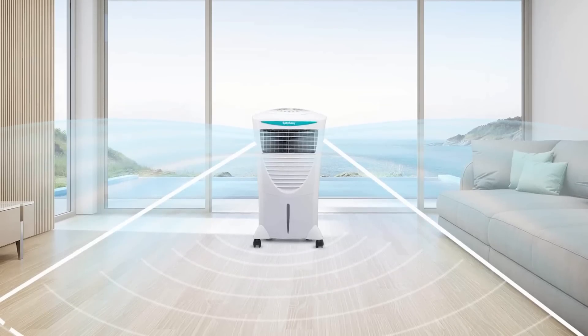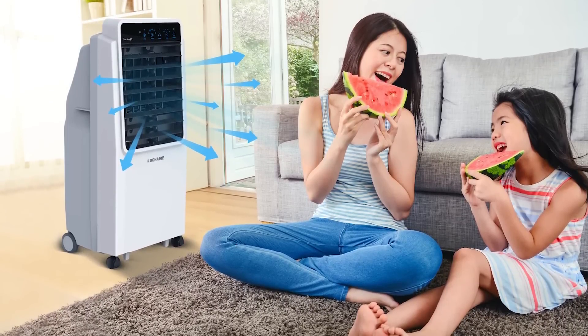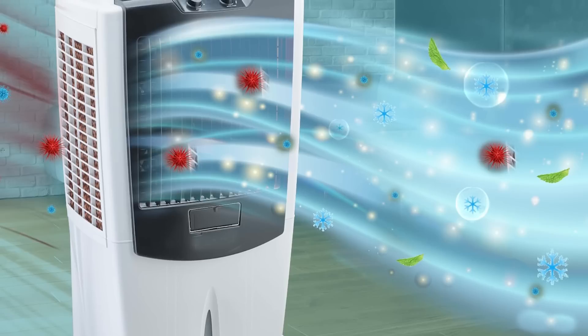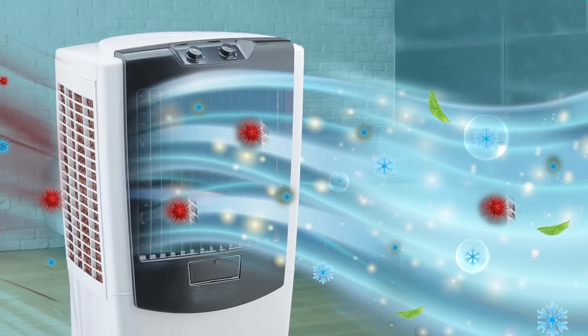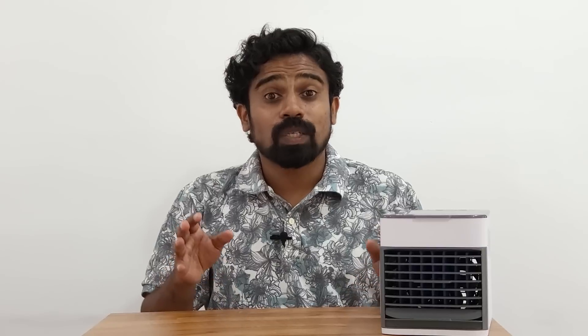If you have a water tank, you can keep fresh air flowing. There is a humidity concern — you should keep the water clean and warm water should not be left stagnant. The sponge can develop bacteria and fungus over time. It is very important to disinfect the sponge regularly. The sponge is the primary place where bacteria and fungus can grow inside the air cooler.